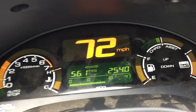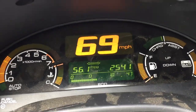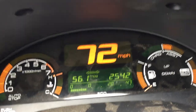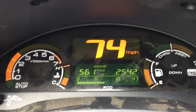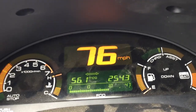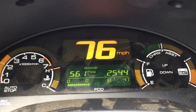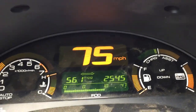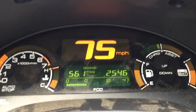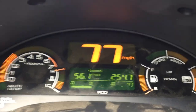So I will say that, as Mario has noted very well in the documentation, the zero can only be on or off. It cannot be anything besides zero or nothing. So that's going to be a good binary. Currently, it's not implemented, so you cannot remap the zero digit. The 50 can display numbers 0 through 9, and then 10 through, I believe, 90, but not 11, for example. So only 10, 20, 30, 40, 50, 60. And that is because the 0 on the 50 is either on or off again.